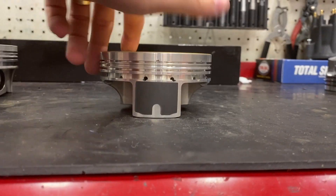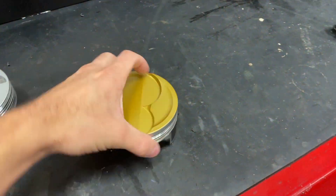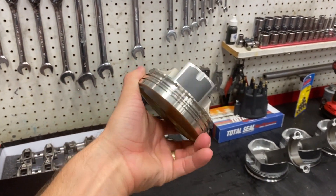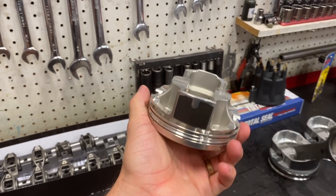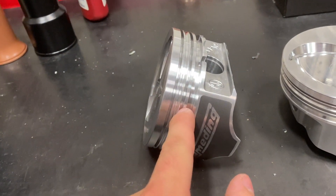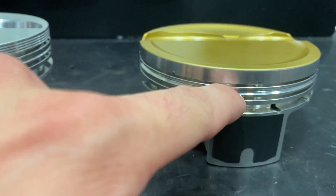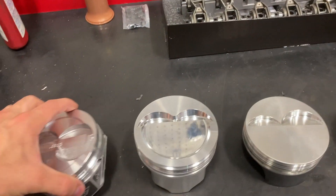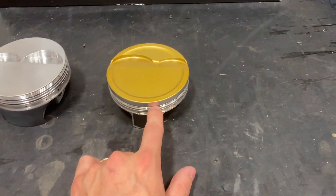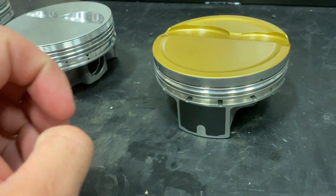These are super heavy duty forgings with a lot more struts in them. One really cool thing is the skirt thickness varies: on one face it's thin, but on the thrust side it's a lot thicker, because that side takes the pressure as the piston travels down the block. The thinner skirt never has serious pressure on it, saving weight without sacrificing anything. Another nice feature is the accumulator groove — a smaller groove between the top and second ring — which disrupts a detonation shockwave coming over the piston, so if it gets past the top ring, the accumulator groove disrupts it and prevents ring breakage.